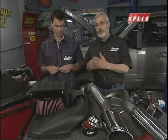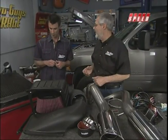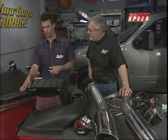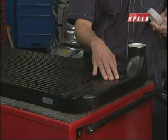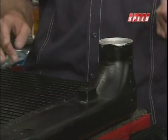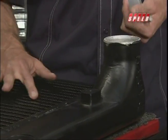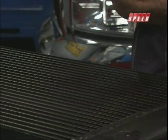Once you run it through the compressor section of the turbocharger, the air starts to get warm, so now you need to cool it again. This is a really cool intercooler — it has a cast aluminum end, which is very expensive to tool versus the normal sheet metal piece most would have. They've also opened up the tubes, made them very big so it'll flow really well. Take the ram air and the Technicooler intercooler together, and you're going to have a continuous supply of cold, dense air.